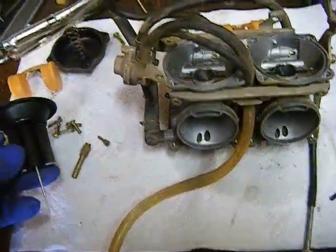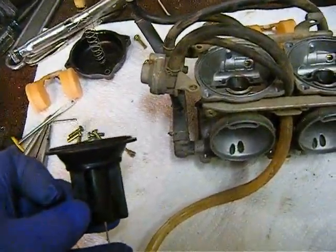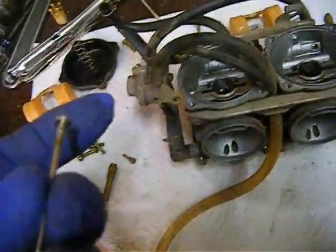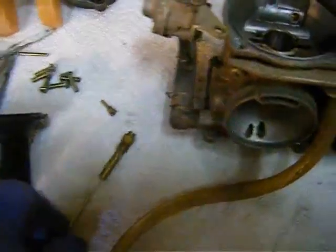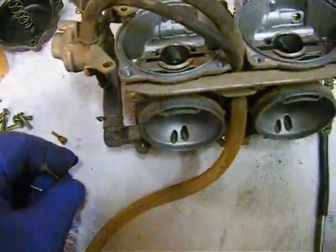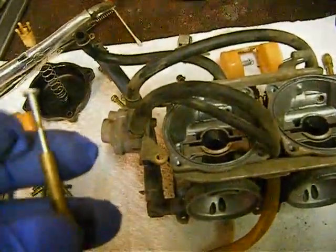Here's how this works. This has a needle on this little slide with a little gasket on top, and it has a pin at the top but it's not adjustable. This is the main jet — it's screwed into the body of the carburetor and the needle goes in there. At idle this is preset, pulled out enough so you can see those little tiny holes that the gas comes out of just a little bit.